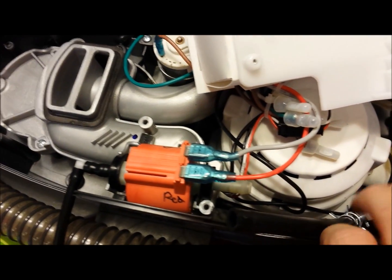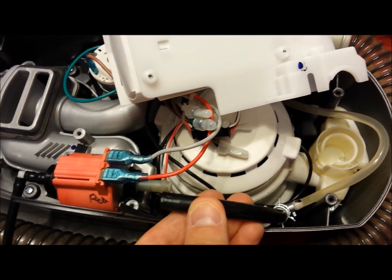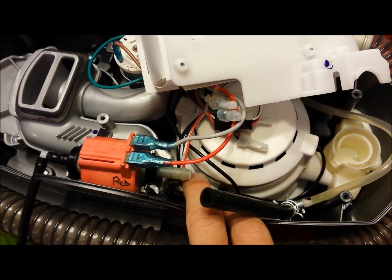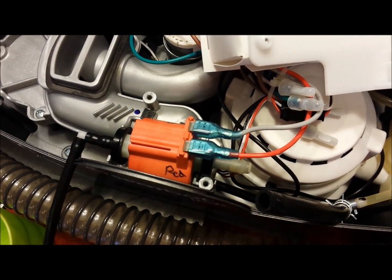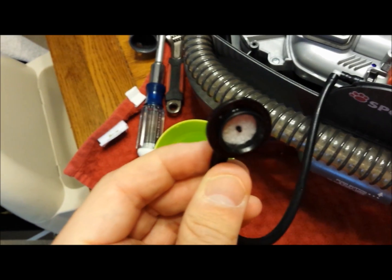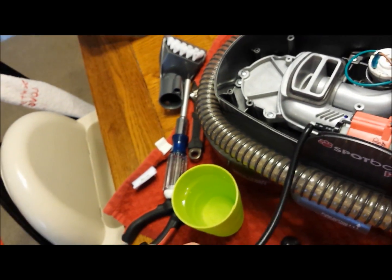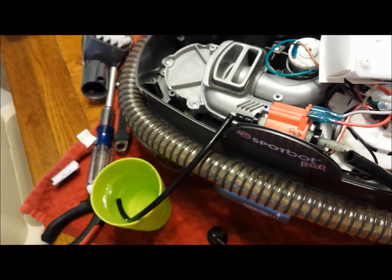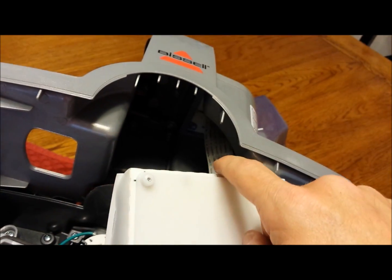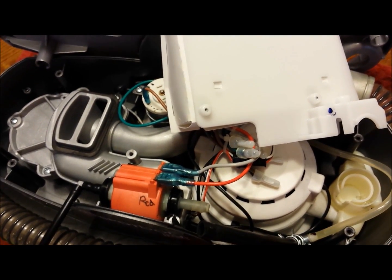Before reconnecting the black tube going to the cleaning brush chamber and the hose going to the hose attachment, leave those off for now. We want to first check if anything is coming out this open end. Carefully hook everything back up, then pop off the piece at the bottom of the cleaning reservoir. Get a small glass of water for the pump to draw from, and carefully reconnect the band connector at the top.